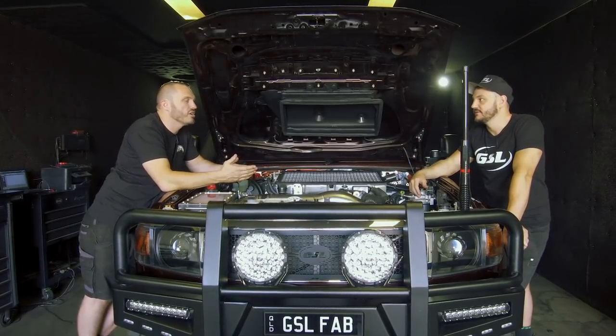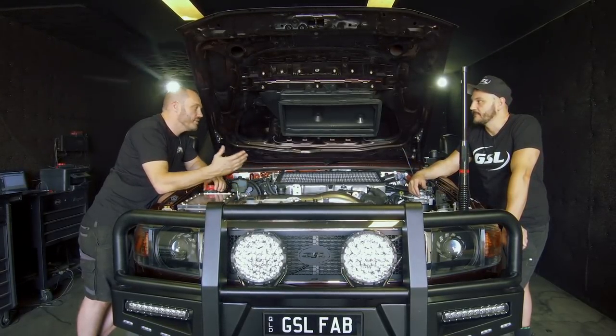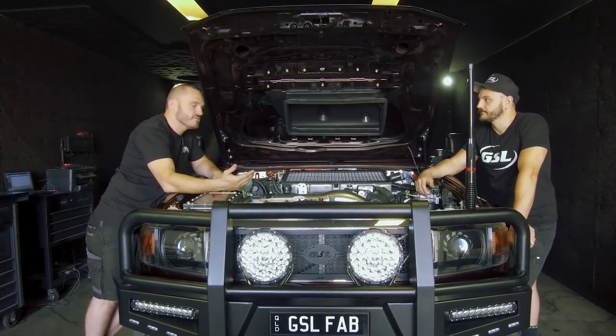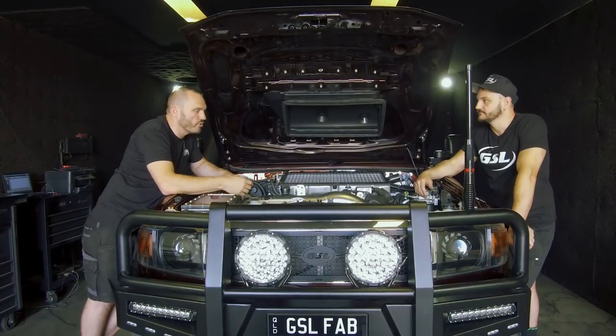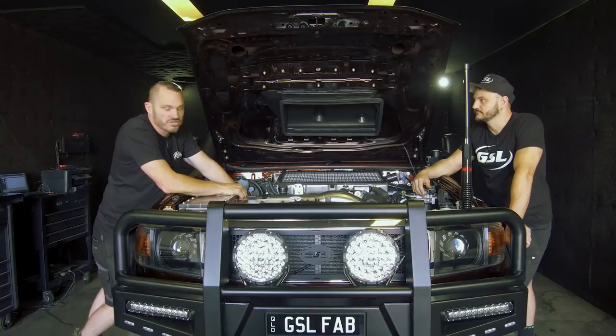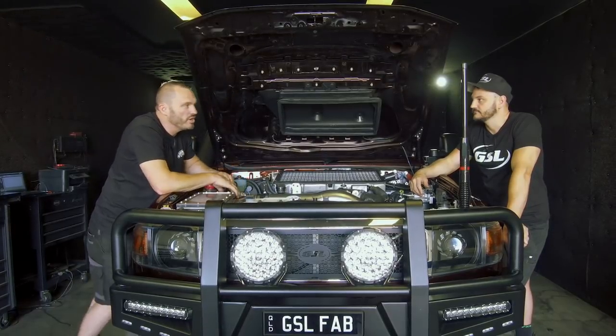That's right, a standard turbo's not going to be efficient at 30 PSI or 25 PSI. You're taking it past its efficiency range because of the supporting products beyond the turbo, being a standard intercooler, or the duration, or the injectors not being big enough. I mean, we don't guess with that kind of thing.